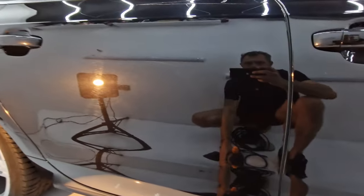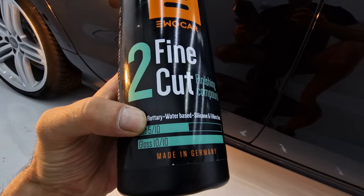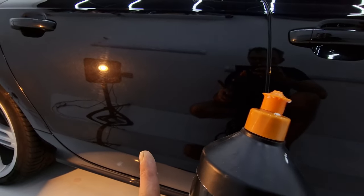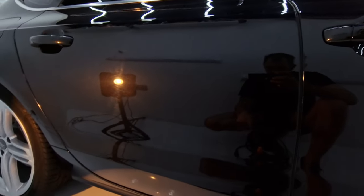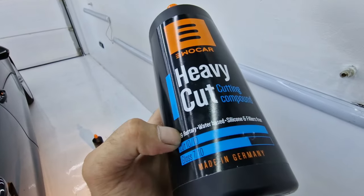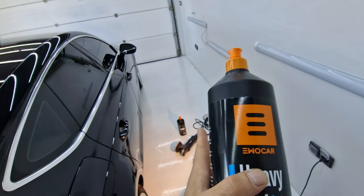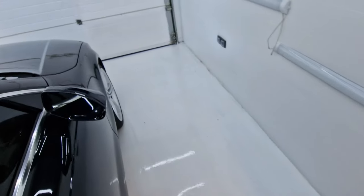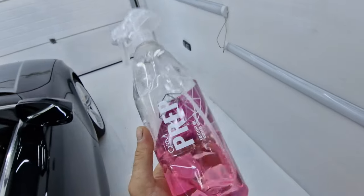So when choosing a paste, why did I choose fine cut? Because it has gloss ten out of ten and cut five out of ten — that's what I need for one-step polishing. Realistically you want to remove 40 to 50% of all damage on the clear coat without leaving holograms, and we do this with a double action polisher. I also have a heavy cut paste here — cut ten out of ten and gloss seven out of ten — which is also a very good paste for one-step polish if you choose the proper machine and microfiber pad.